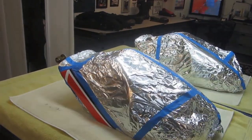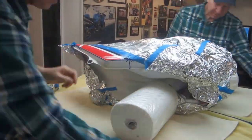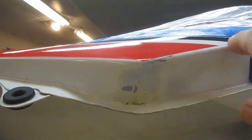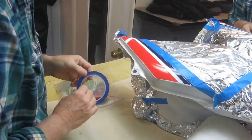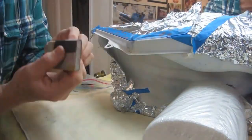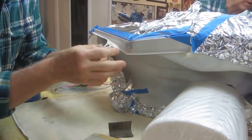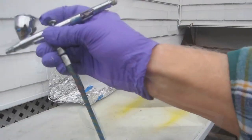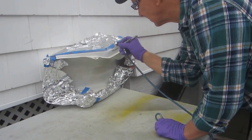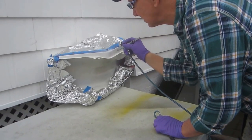After several coats of clear, moving the tape back — now it's got to dry. I want to back mask that and leave the bottom of the tank exposed. The bottom of the tank had some issues. I wanted to back mask it again, trying to avoid having a paint step where one area ends and the other doesn't. This involved a lot of little touch-ups with a brush. Now I want to airbrush using an Iwata airbrush and some touch-up paint — luckily I had some touch-up paint that was a close match. Get that bottom airbrushed and get a little bit of clear on it, just enough to protect it. The airbrush is the easiest way to do this — it doesn't build up a heavy paint line or edge. This is Dale's pride and joy and I know he wants it perfect.